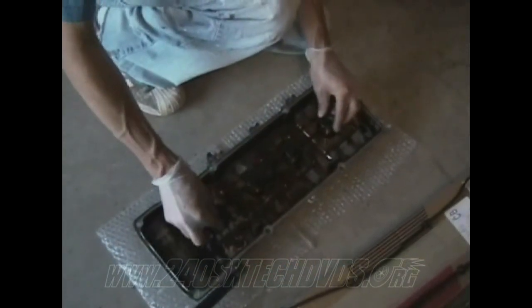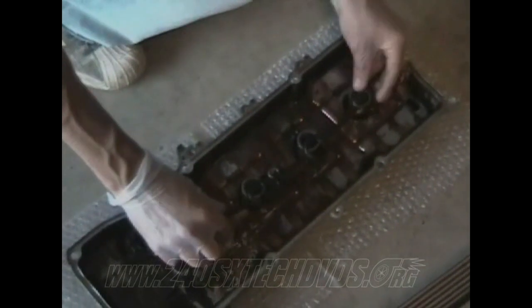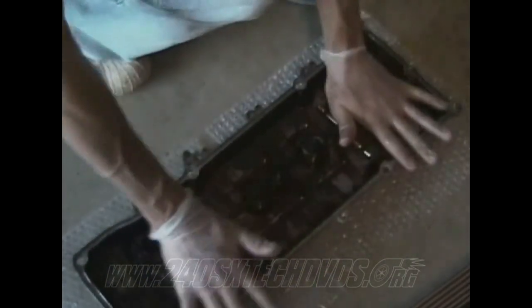Next, you want to put on your valve cover gasket on the spark plug holes. Just press down in there. You don't really need any liquid gasket in there either. And if it leaks later, it's an easy pull off and fix if you have to. And then your gasket just goes down in these little channels right here, which is another reason it'll usually seal real good.